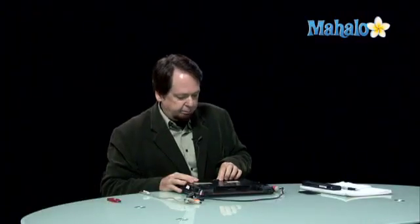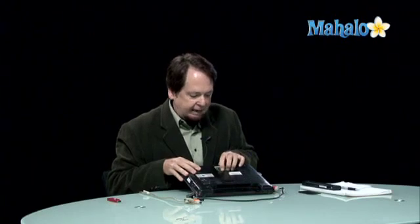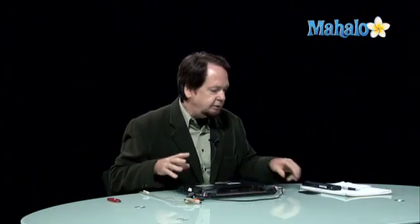Notice that there is a notch on the chip. When you're inserting a chip, you'll need to line up that notch appropriately and gently slide the chip in. There will be a minimal amount of force needed to seat the chip fully, and then you simply press the chip down — it will snap neatly in place. I always give the RAM a little wiggle to make sure all those gold contacts are touching each other.